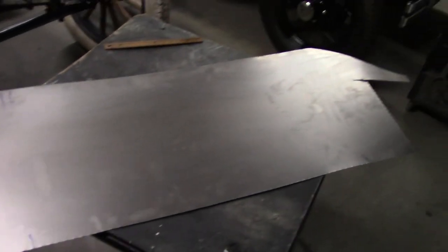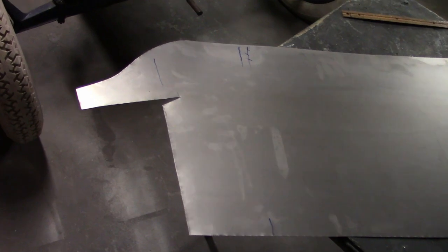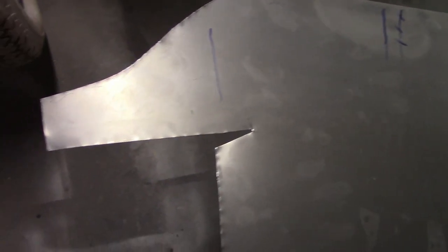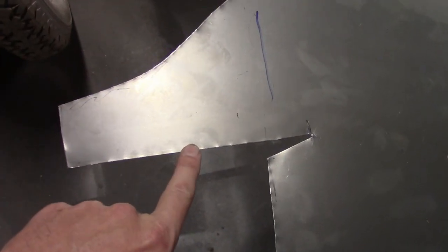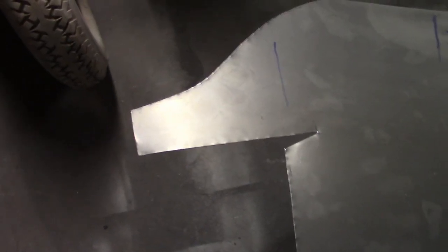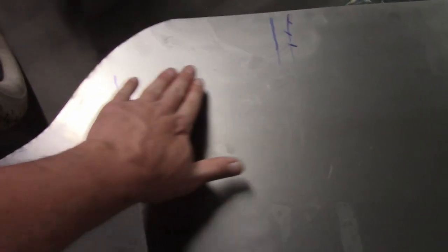Here's the beginning of the new panel — I've already cut it out, ready to go. As usual, I cut it out oversize and I'll trim it down as I start to form it. The only thing I cut right on target is this line here, because this is where it's going to sit on top of the side panels, and it goes in exactly as far as the original. We'll mount it to the body starting there and trim everything else down to match. The next thing is to start curving this out — I've marked roughly where it starts and ends on the original.